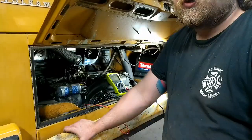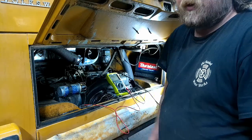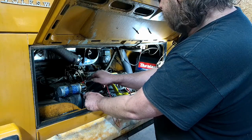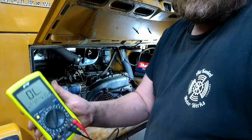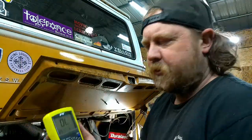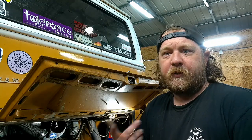All right, guys, if you run electronics, or never ran electronics, you need a 3 ohm coil. If you don't know how to test them, I'll just show you real quick. Throw your digital meter on the horseshoe mode, and just go terminal to terminal. Beep, boop. 1.8. Well, you can't see. It's 1.8. Not enough resistance. But horseshoe mode on 200, terminal to terminal, and that'll tell you what ohms you have. You want, like I said, a 3 ohm coil.